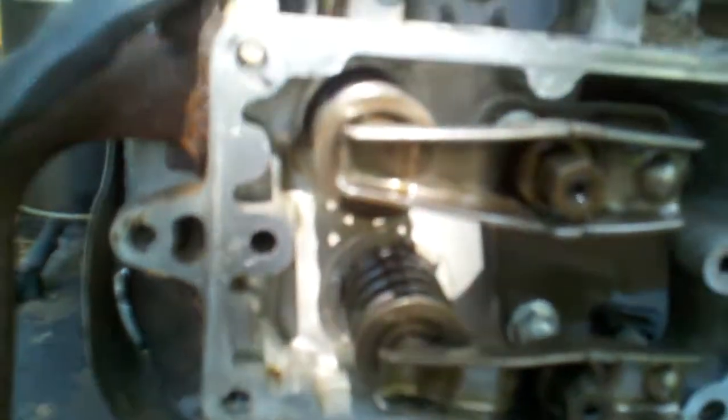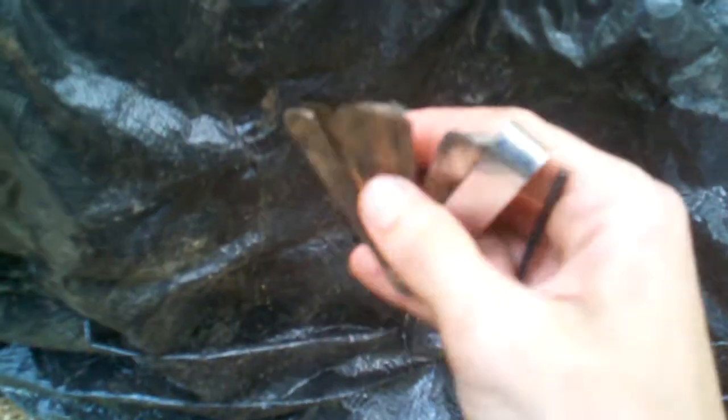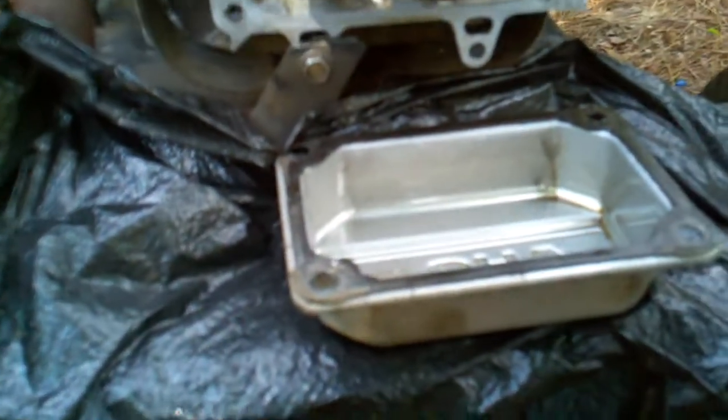That's how you do it — that's all there is to it. Now, your feeler gauge — if you don't know what this is, you probably shouldn't be in the engine, but it's something nearly anybody can do. It's just different thicknesses of metal, like different thicknesses of paper. You stick one of these sheets in there and it gives you a little bit of space. It doesn't look like much, but it makes a difference whether it's too tight or too loose.